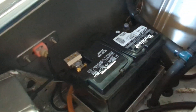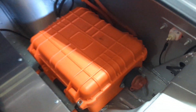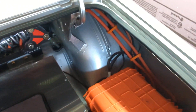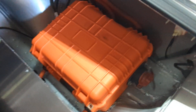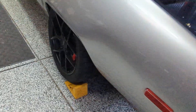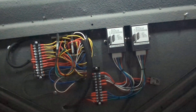Before doing any of this wiring I make sure that the 12 volt battery is disconnected and also the 400 volt battery is disconnected. The 12 volt is just like any other car — it's chassis ground — but the 400 volt system is actually completely isolated from the car. This is just a break in the circuit which makes sure there's no high power going to any of the high voltage components. Just rolling the car back a little bit to make some clearance.